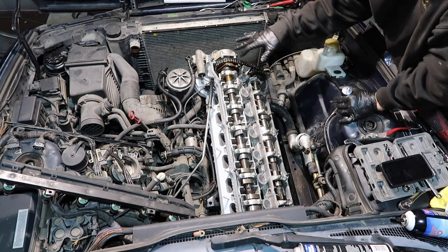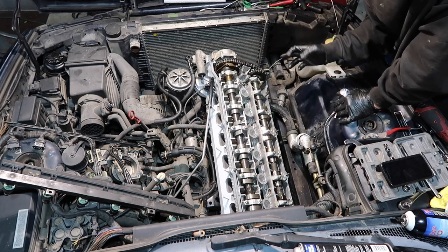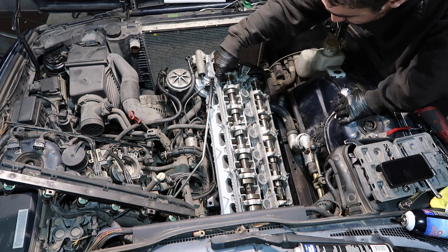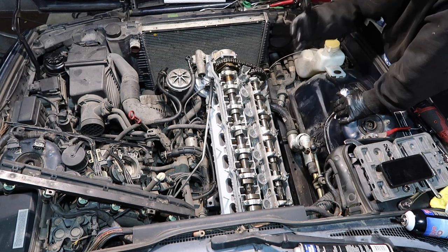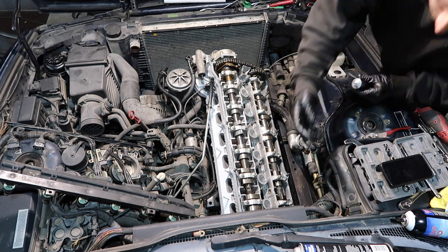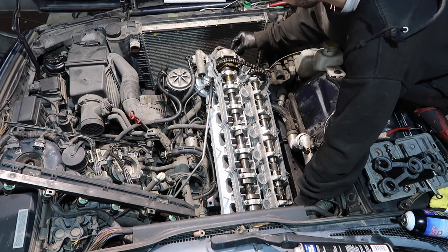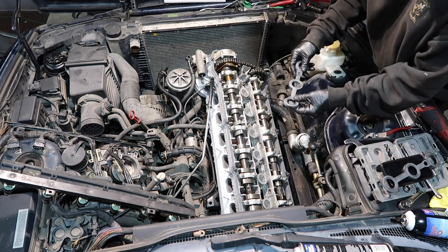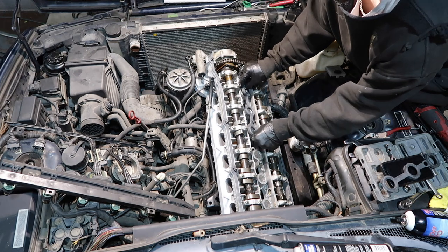So, you guys know the drill, RTV at the seams, at the half moons, and also this machine shop brilliantly decided to stamp the cam caps to remind themselves which was which into the valve cover sealing surface. So I'm gonna RTV over that because that's just stupid. I don't know who would do that, but. Okay, and don't forget the spark plug wells.